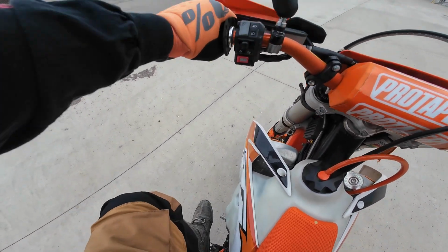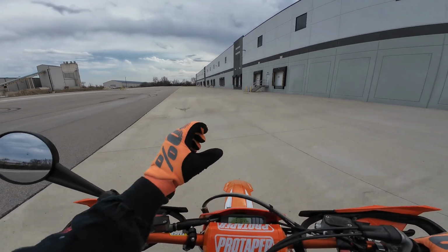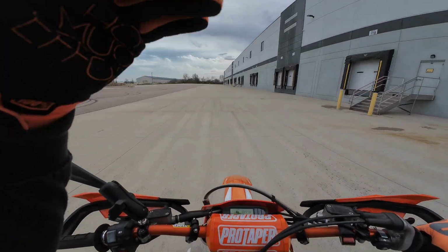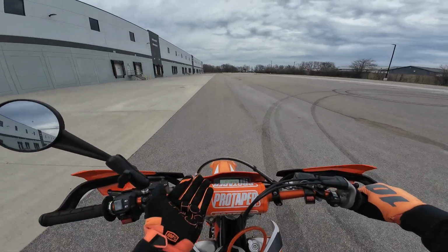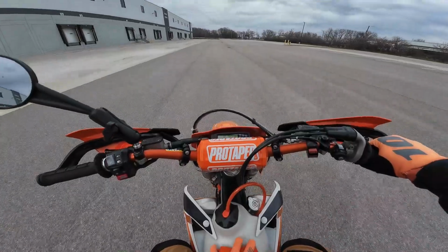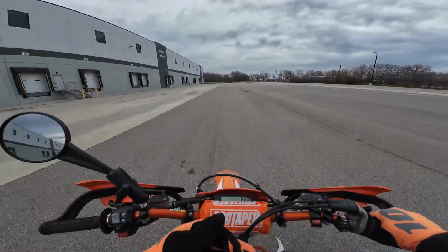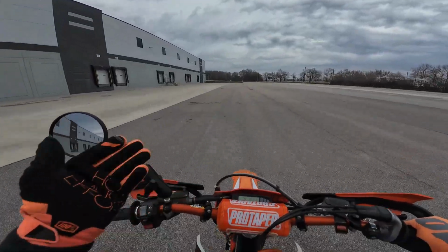We're in neutral, click down, we're in first. Now, very similar to how we start out with letting the clutch easy out, introducing throttle again, we're going to use that same principle to get up to second gear, okay? You want to get kind of higher up in the RPMs in first gear. You get to where you can feel the engine kind of vibrating. That's the engine saying, hey, you got to put me in a higher gear to make it easier on me.